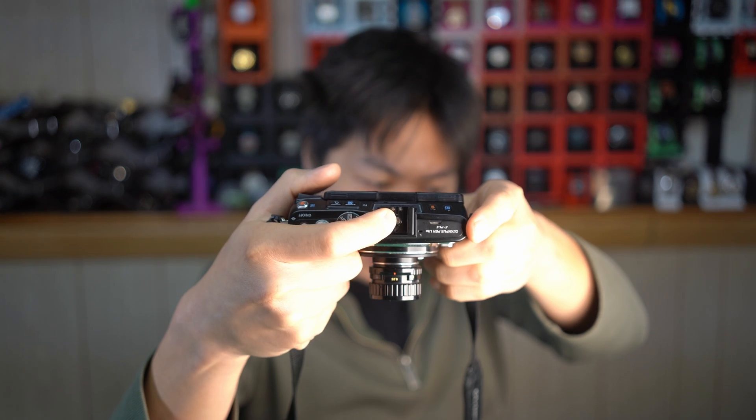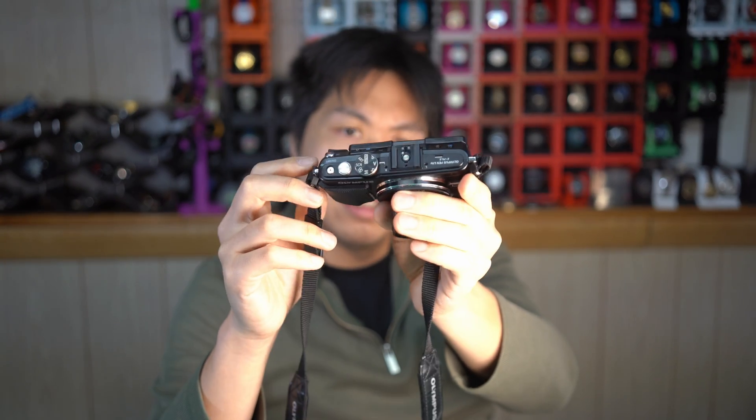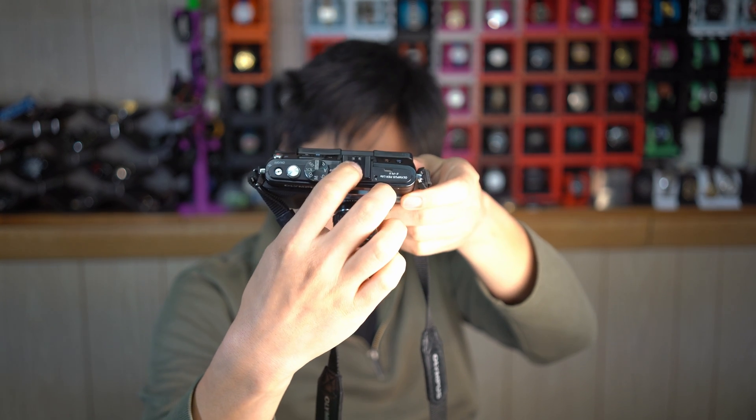Something to note is this hot shoe here. When you're disassembling the camera, you'll be removing a bunch of screws from here, and then it'll come time to lever this thing out. The way the rear case is attached to the main body means that if you aren't careful, you can very easily destroy this part of the hot shoe — like I did on mine. My hot shoe, this part, no longer works. Not a massive deal for me as I have the EVF permanently on here, but it might be for some people.